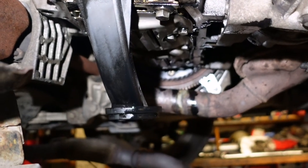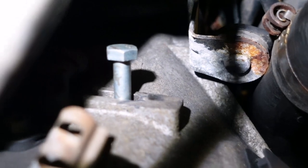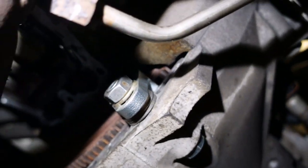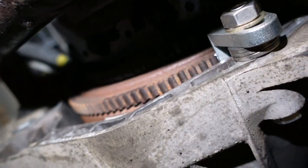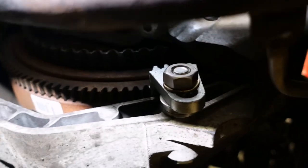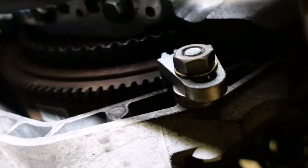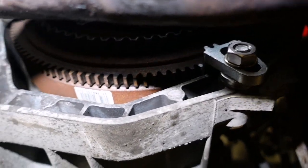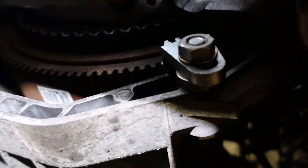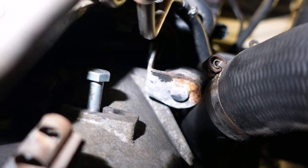What I've also done is held the flywheel. My positioning pin is in, so we know the flywheel is in the correct position. I've stuck a bolt through the bell housing and because we have the flywheel exposed with all the starter ring gear, I'm going to use one of my teethed holding tools. In this case it's going to be a double belt-and-braces type of thing - if my counter-holding isn't very good, this will save me. Because if you put a load of torque on that positioning pin up there and you bend it, you're not getting it out.